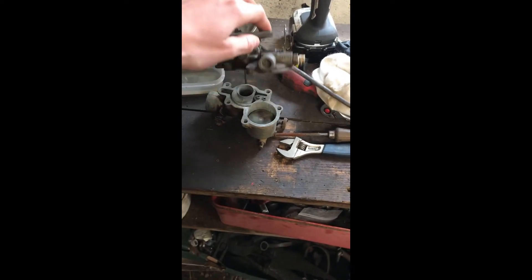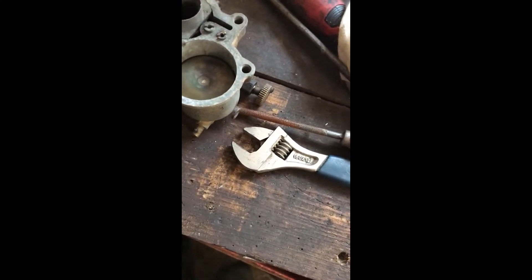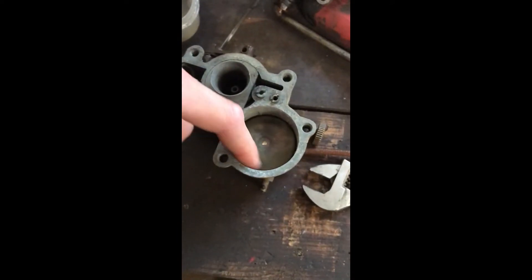You can see all of this is taken apart. I had to take the carburetor off again — there's supposed to be a carburetor here. I took the fuel line off again. The carburetor is over here and they're not meant to come apart like that in normal operation. I've taken it all apart, washed it all in petrol, and cleaned the float because it was sticking at the bottom, not letting fuel through, then flooding itself and coming out. I've gone in with a paintbrush, cleaned it all out, and blown it out with an airline.